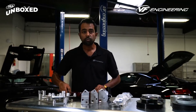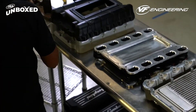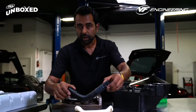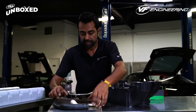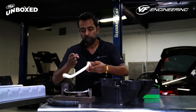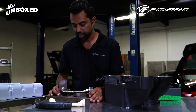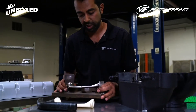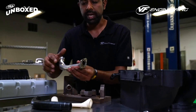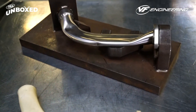Let's have a look at a few more accessories in the supercharger kit. The serpentine belt was actually obstructing one of the thermostat hoses, so we eliminated that and drew it in CAD — in SOLIDWORKS — checked it for flow through cross-sectional analysis, and then created a fixture. This is a pretty bulky fixture designed to last. The fabricated stainless steel piece is CNC machined with specially bent and crushed pipes, all tested in this jig.